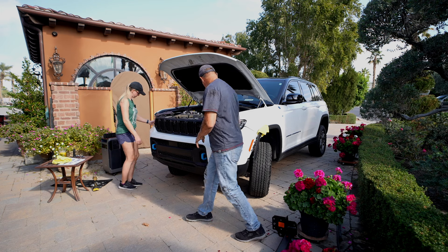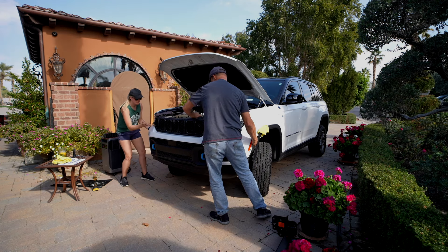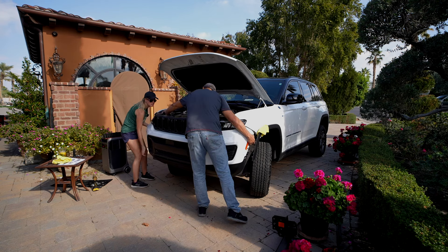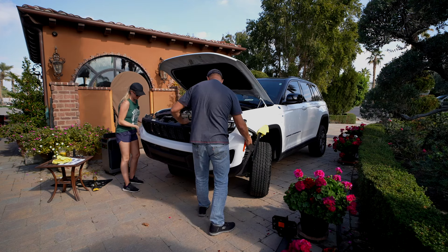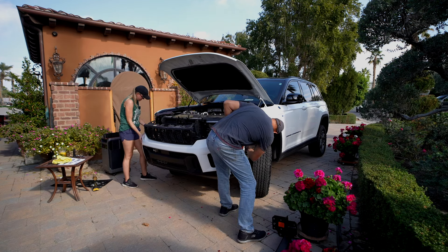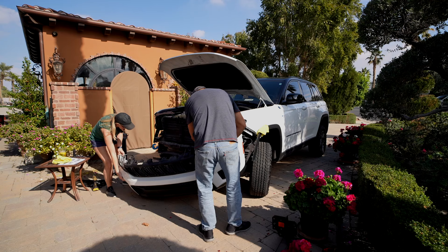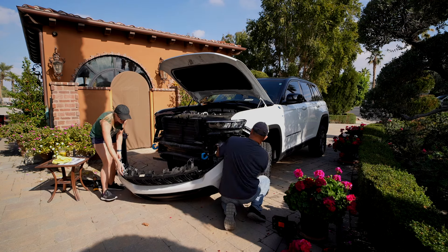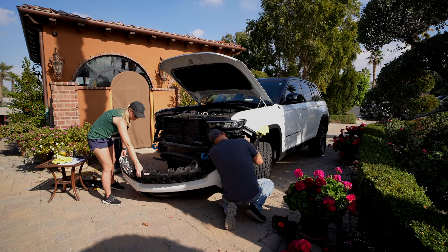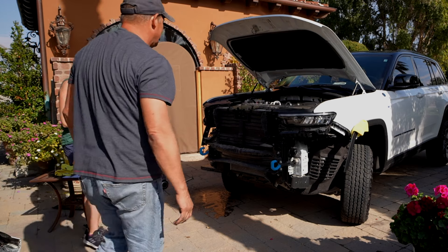So Miller, if you grab that side — this whole white part is just going to wiggle off. Just wiggle it a little bit — there you go, we got it. Now just look for any wires that are still connected. There's one over here and one over here — it's going to leak water for a minute. There are wires for all the front sensors, the headlights, the LEDs, the infrared, all that kind of stuff. Now just lift it up and out of the way. There you have it — now we're down to the front of the Jeep.